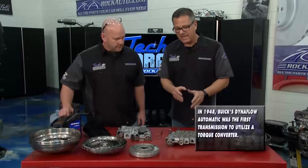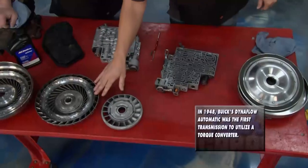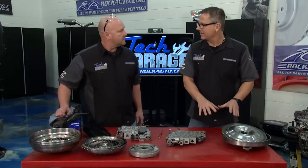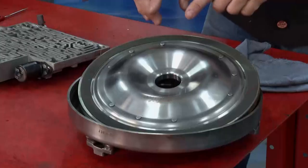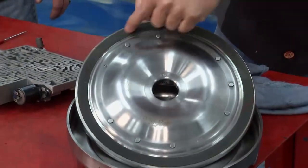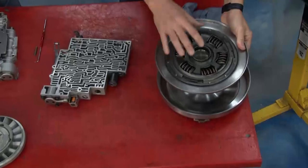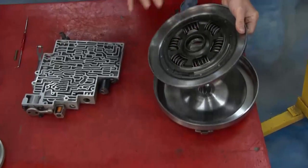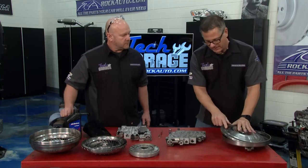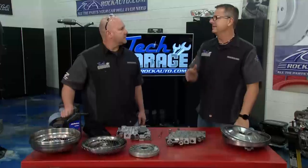The regulator valve allows fluid to go through the torque converter. You've got the impeller, the turbine, the stator — but the important piece is the actual clutch inside. This is the actual slippage — when you get to lockup, direct one-to-one. This material is face down and it locks up with fluid pressure. Once it locks up, you're in one-to-one drive. If it's not getting fluid pressure because of a problem with the valve body, hence slippage from input to output.